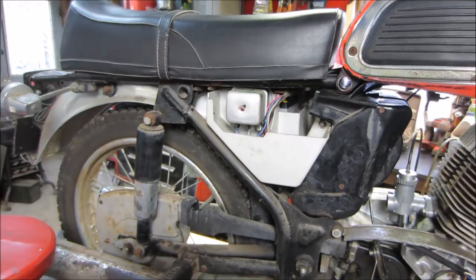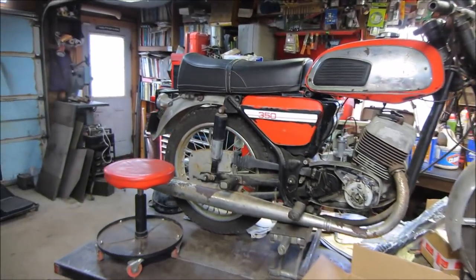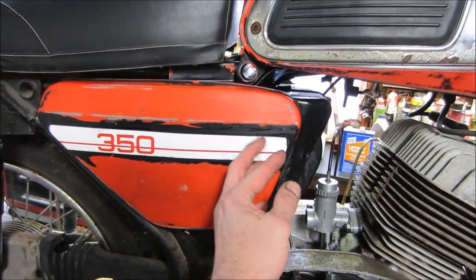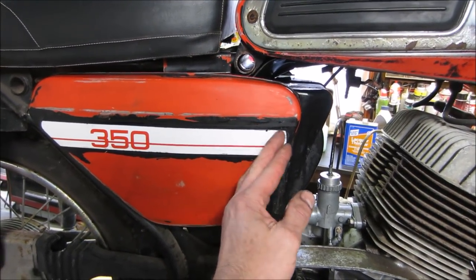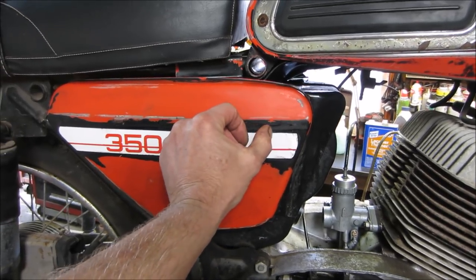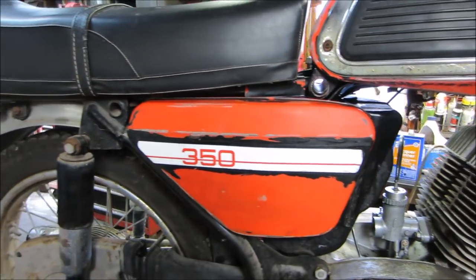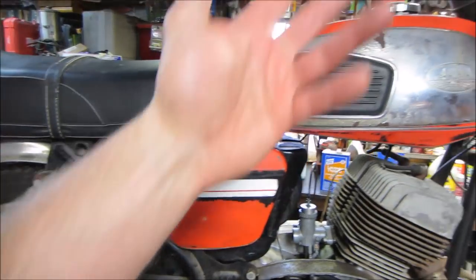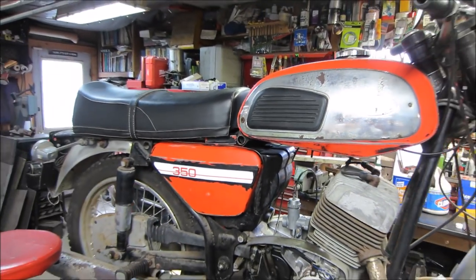And we're getting there. I taped off the white section, so I got some masking tape on it. And I started wet sanding it. It really was fighting pretty hard. So I went back with a lacquer thinner. And that seemed to loosen it up pretty good. Again, still kind of burning through in different areas. But again, now it's going to match the rest of it.